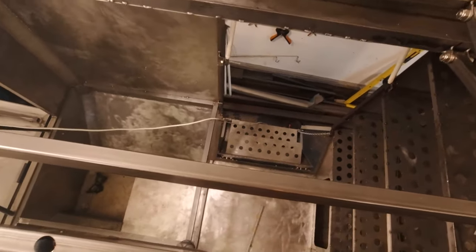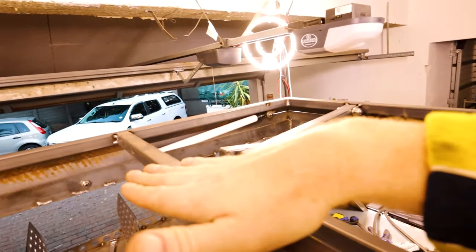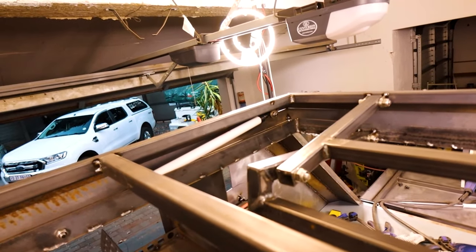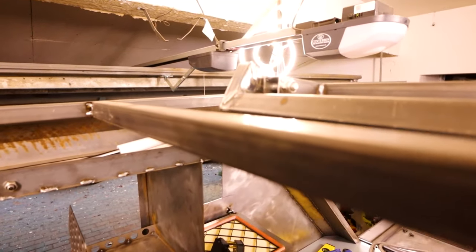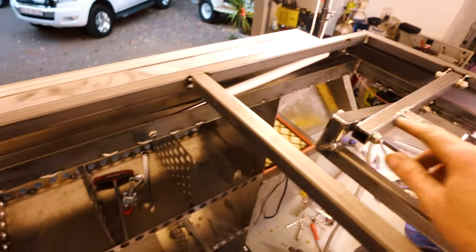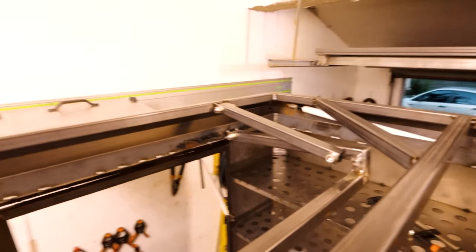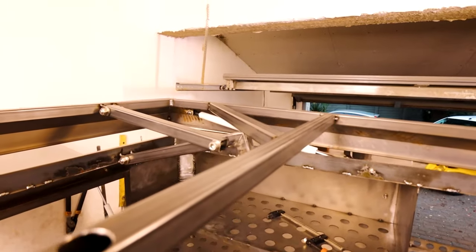I want to quickly show you an issue I've got and how I plan on solving it. We're going to have a one millimeter fiberglass sheet covering the roof, which won't be strong. Now this corner over here — if you lift the roof and don't lift it up perfectly straight, that corner pokes through and is basically going to knock a hole in the roof. I need to create a mechanical stop for it to go against instead of pushing through the roof, which is what this piece over here is. So now if you grab the handle and start lifting, the roof can only lift until it hits the stop, so it can't poke through — and then the roof starts lifting properly.